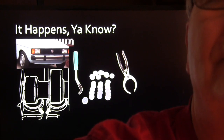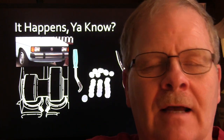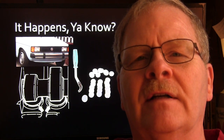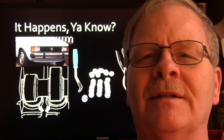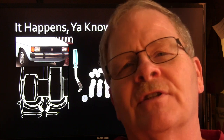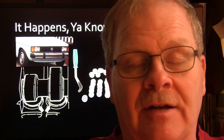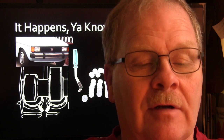These Volkswagen diesel Rabbits that I worked on for a long time at the dealership had valve adjustment procedures that we did so regularly it was a standard procedure. You'd have the lobes up on the valves, and you'd have a go-no-go feeler gauge for your exhaust and your intake. Then you would use those little shims that the parts manager had, a whole big tray of them lined up in order. You'd measure, pull the shim out, and either mic it with a micrometer.